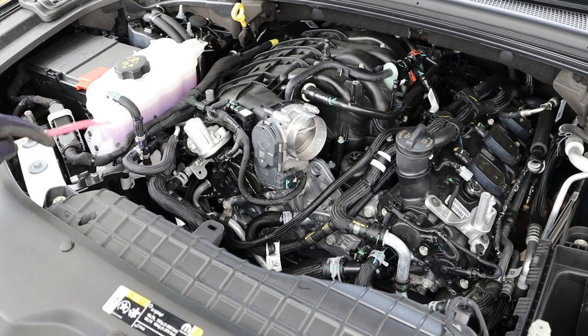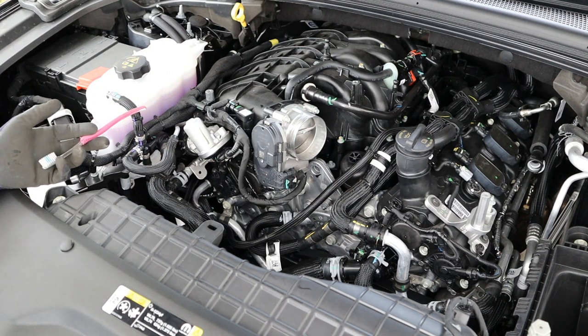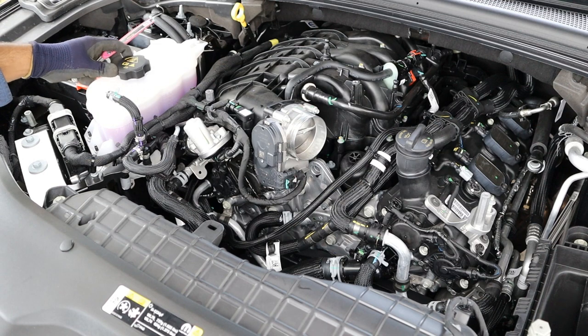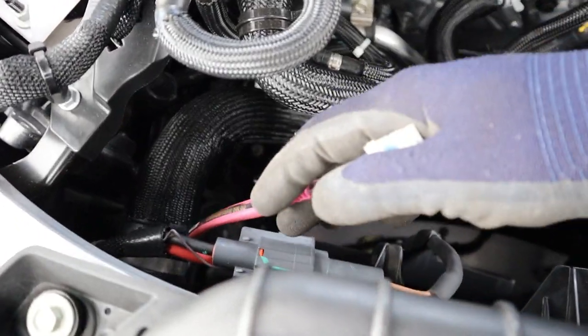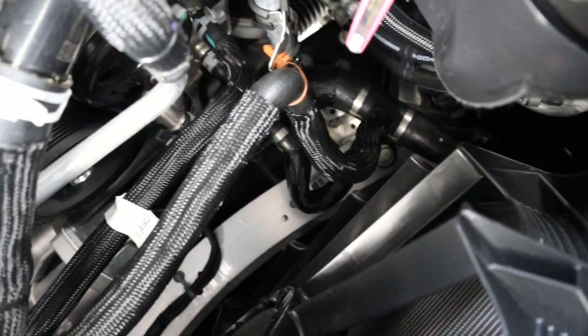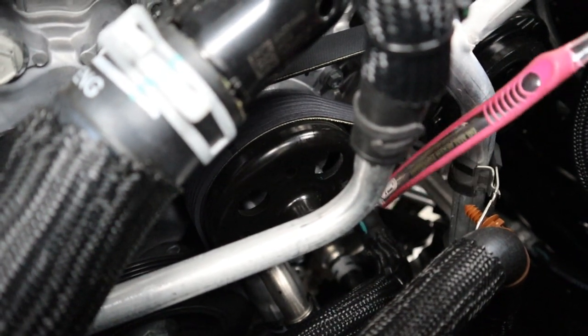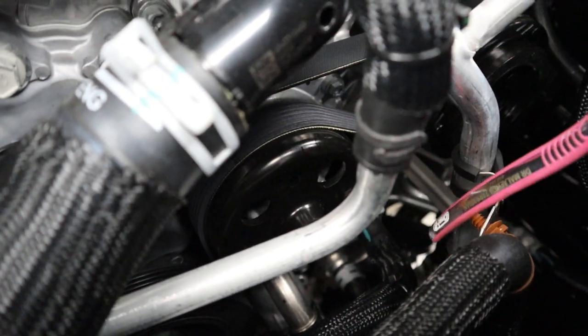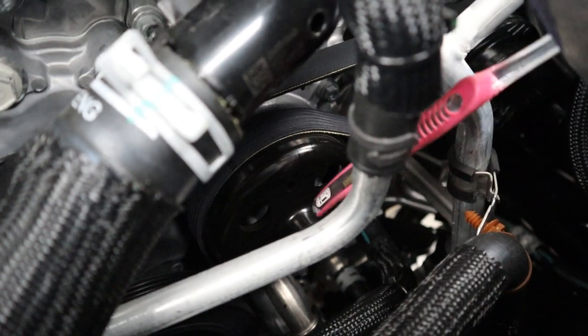Looking at the cooling system on the Grand Cherokee, things are actually pretty simple — you have to appreciate that they're still using naturally aspirated engines. At the top is the coolant reservoir with the pressure cap, then hoses that lead to the radiator and the engine. You've got the upper radiator hose coming from the thermostat, which is unfortunately in a plastic thermostat housing along with the engine temperature sensor. Down over here the lower radiator hose leads to the water pump driven off the drive belt. Unlike some GM and Nissan vehicles where the water pump is buried inside the timing chain, Chrysler put it outside the timing chain cover where it's pretty easy to access — once you get the belt off and clear the hoses, it's just a couple of bolts off that timing cover.